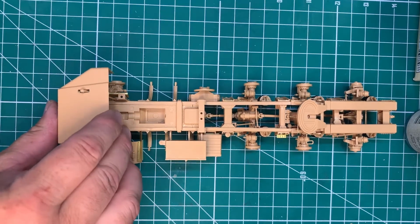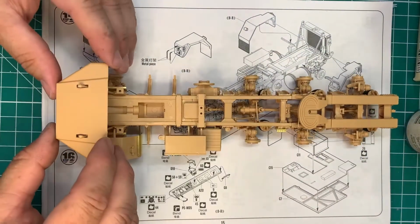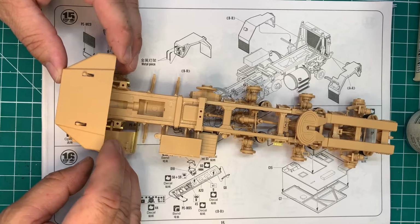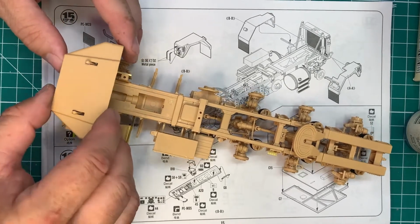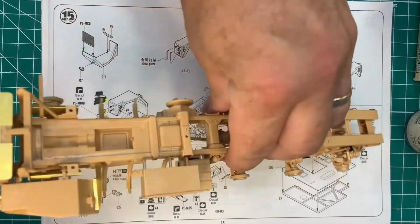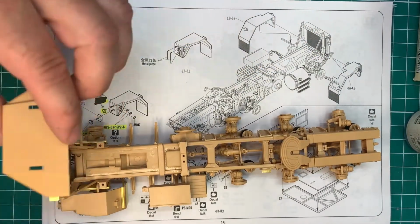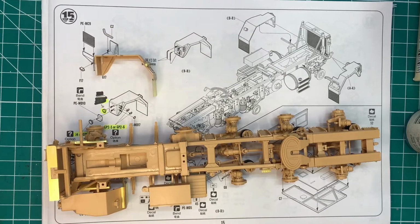and it will fit. So what you want to do in this case, as far as fitting these fenders on, is when you get the left and the right, okay, this needs to be square, is what you're aiming for more than anything. And yeah, that looks good. That gap is not a problem. So I'm going to take that off. As long as the framework and the fender are square this way, and square this way, framework here, fender here, you're going to be able to fit your part on and have it fit the way it should as the build. So there's big hint number 2.